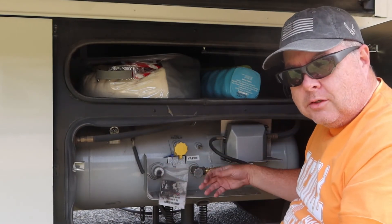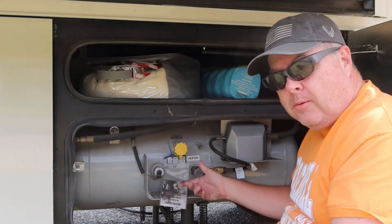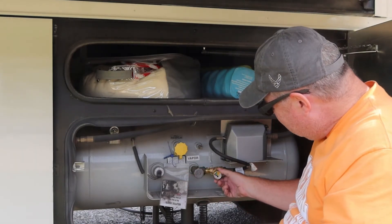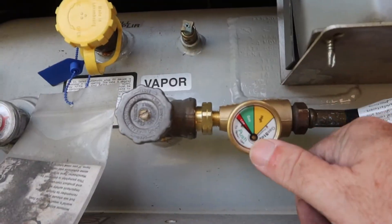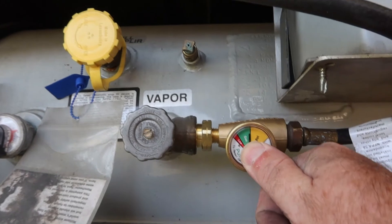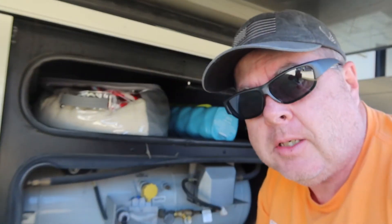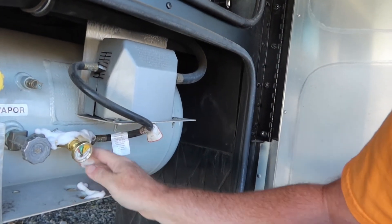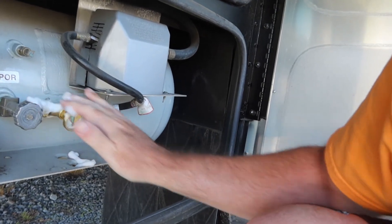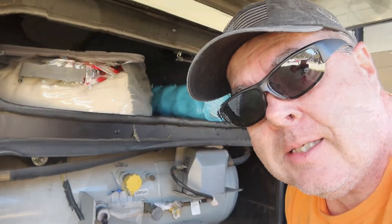We have interior tank indicators as well as one here, so we're not really going to use this for checking propane level. Now we just turn it on, listen for leaks, and smell. We're all the way open — don't hear anything. So we're going to go ahead and prime this. The nice thing is you can turn the dial around so it faces up. Just hit it a few times, push the button in, and as you can see we are good — we are in green, no leaks. A simple quick test is to use a little soapy water — we've got some right here — just move that around the fittings and see if it's bubbling at all. That looks like a tight seal.